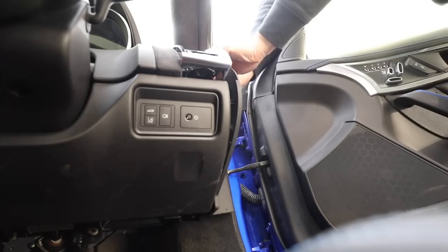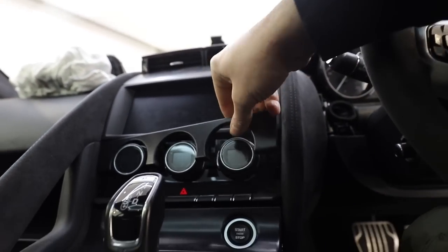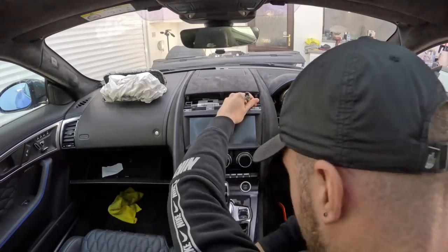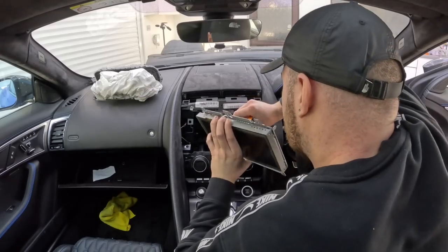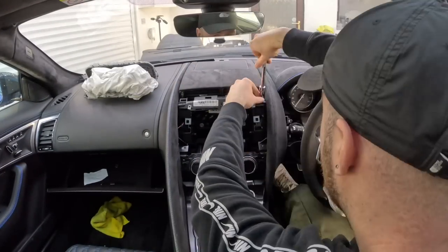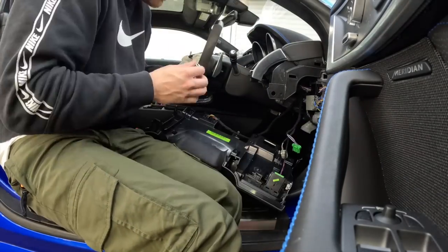I set about dismantling the full interior of this Jaguar F-Type, starting with all of the clip-on panels. I've had a little bit of help in the form of an email from someone that used to work at Jaguar, and they said you can just remove the top section of the dash. There's still quite a lot to remove, but apparently dashboards can get a lot worse than this. The next thing I had to remove was the full centre console and infotainment system. All of the trims come off, which reveals a bunch of T20 screws — countless amounts of them. I found it worked well to nip to and from bits; if I got stuck on something, not to dwell on it for too long, otherwise you can very quickly lose your head doing a job like this.